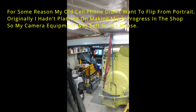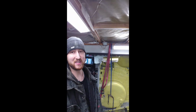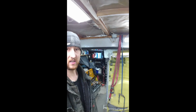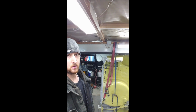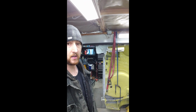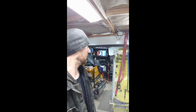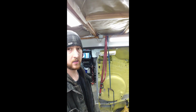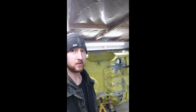You'll notice some changes. Yeah, we don't have the rotisserie on the back anymore. It's over there on the floor. Trying to get this section of frame rail out, the last back section there. Been drilling spot welds. I have a ratchet strap holding the car up to keep it off the rotisserie. I did put a safety in there, floor jack on the bottom, just to take a bit of pressure off the straps. Had to remove the blue strap there just to be able to get spot weld cutter and such in there. And we have bumper bracket down there.